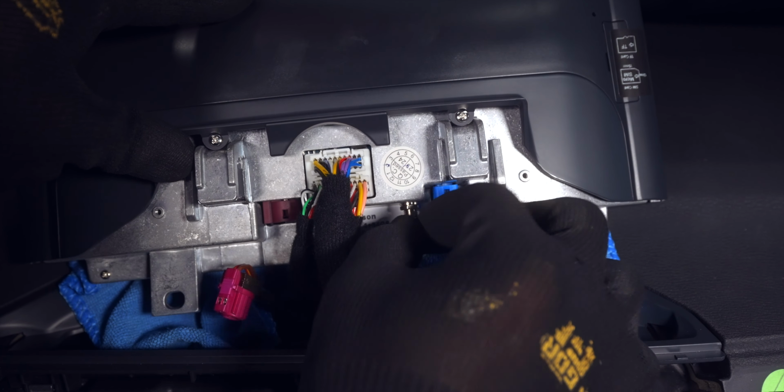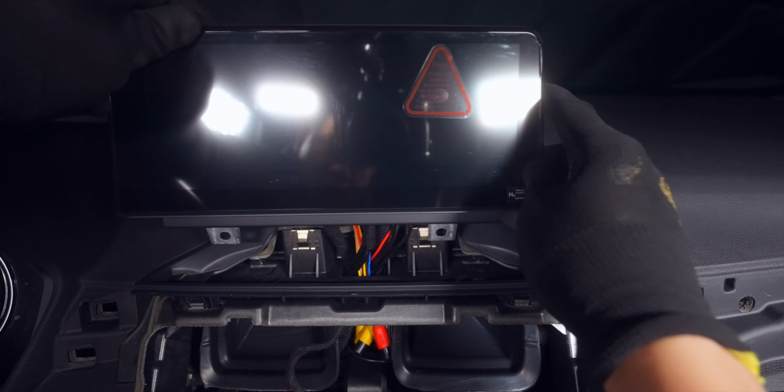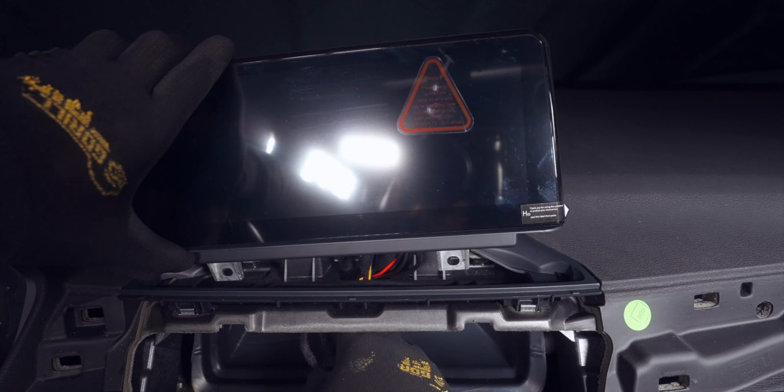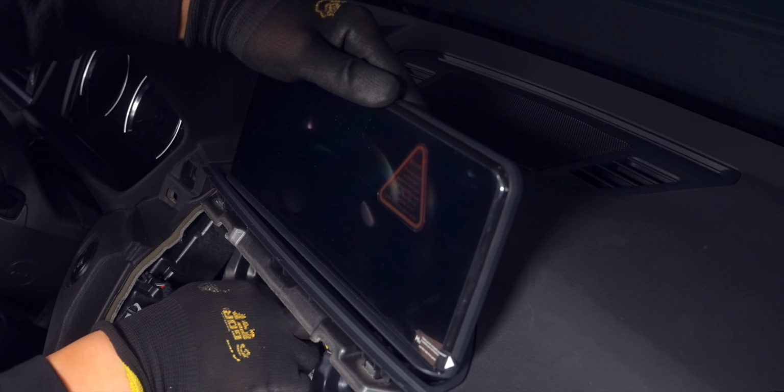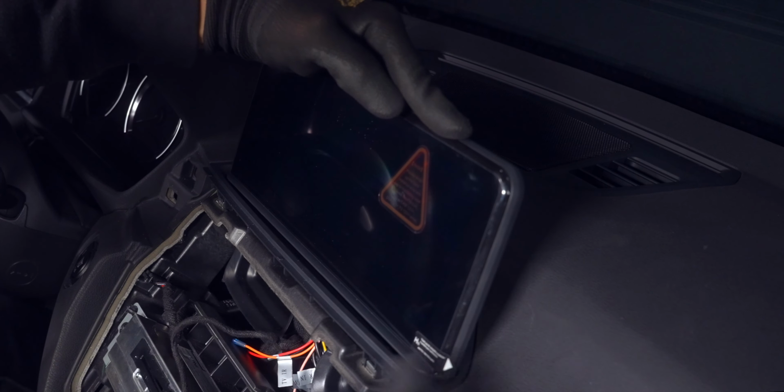The last cable to be connected is our LVDS cable that has the least amount of slack. Let this wire run in between the three middle cables and the screen. This should give you enough space to line it up and comfortably push it in. Doing it this way will also ensure that we have enough slack to flip the screen over and lower it into place. And don't worry about screwing it in for now as long as it sits flush.